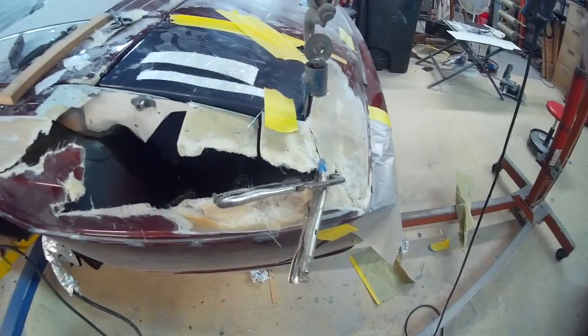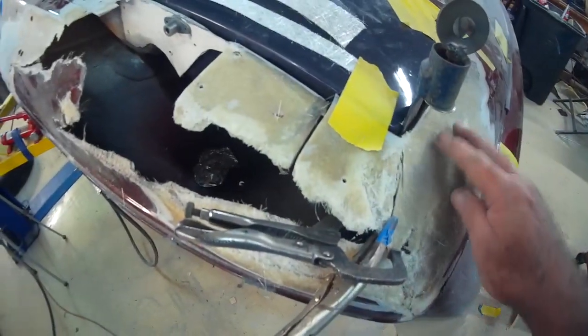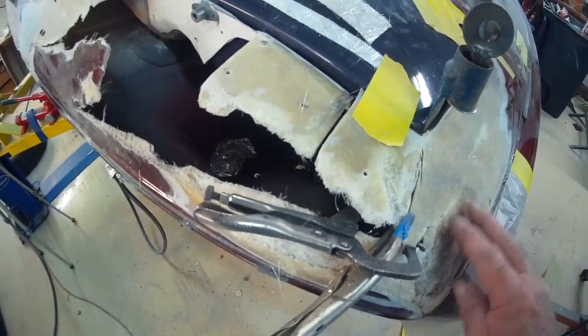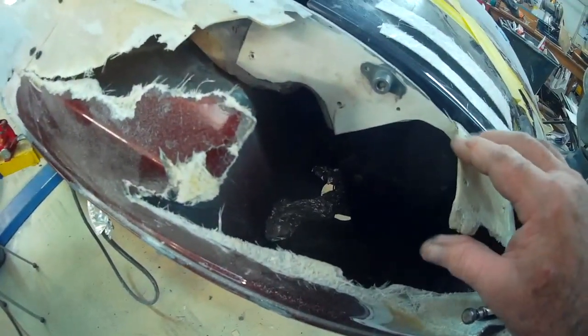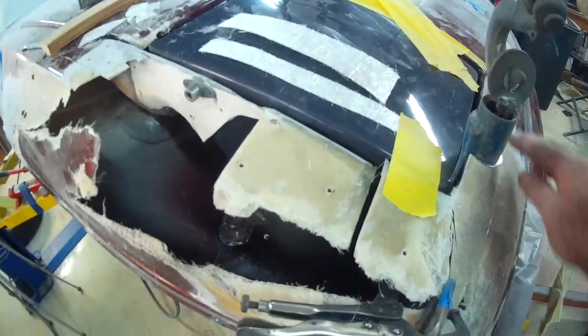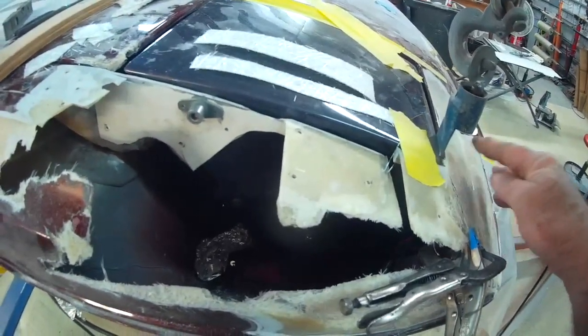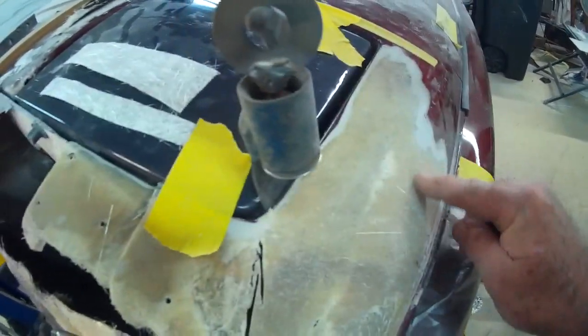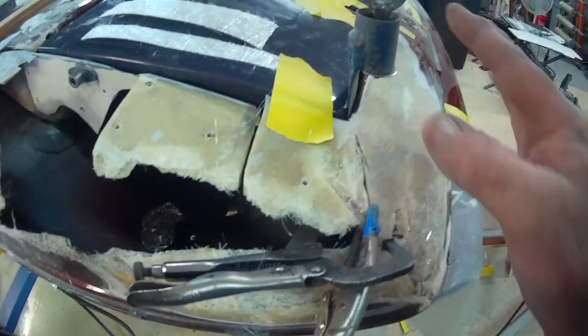We're out here the next day. I've got the headlight set in there. Looks like this area here was low. As I said before, it's just fiberglass — sometimes you've got to cut it back loose. So with the headlight in, got this brought up. Ground all this broken area here — you can see this light area where it's fractured. Got it relieved so it comes back up.